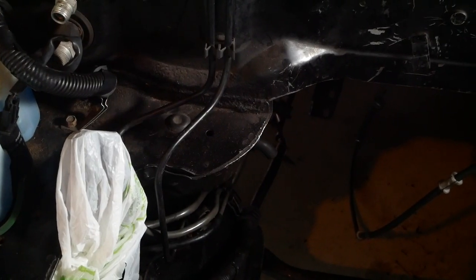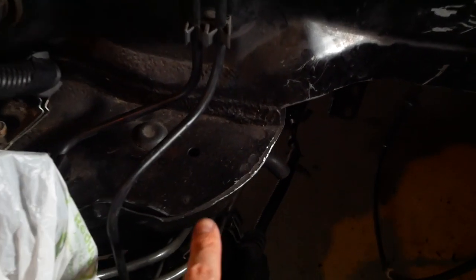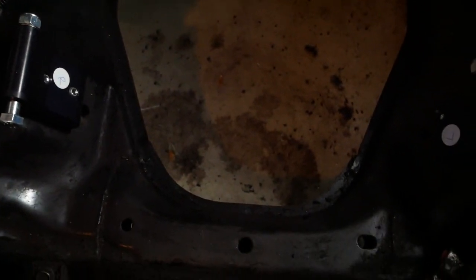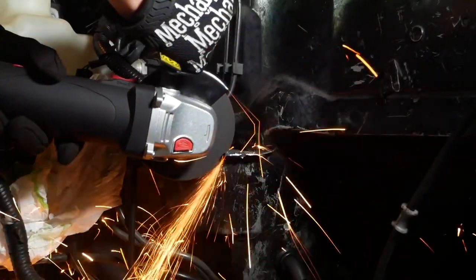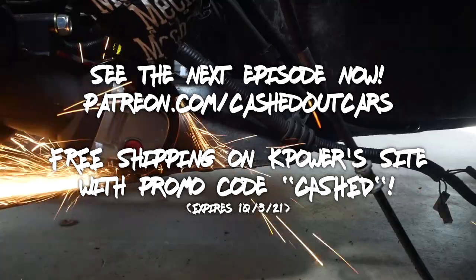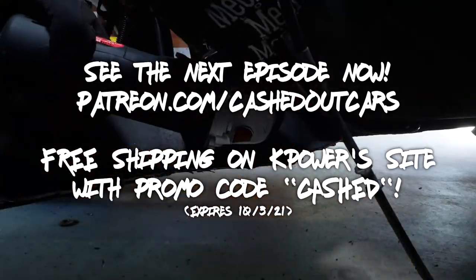We also have to trim some parts of the car so the exhaust can fully clear. This rear shelf back here is one part we have to cut just a little bit — most NA's need it trimmed by about a half inch. We're also going to have to trim a little bit around the very edge of the subframe so that the oil pan can actually clear when it's sitting in there. With all of that prep work, the chassis is ready for the K24. If you want to see the next episode right now it's live on my Patreon. Don't forget to subscribe so you don't miss anything — take care.